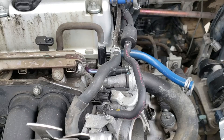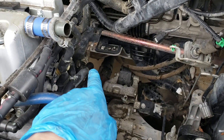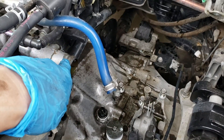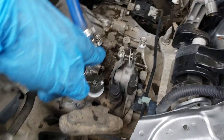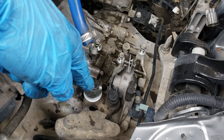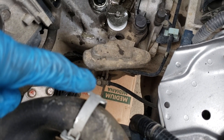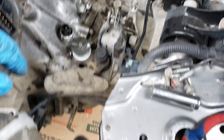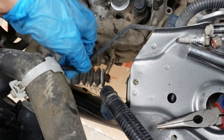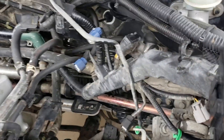You want to unhook all those and then lay it up there. I went ahead and took out the power steering line. Next I'm going to work on taking out the hoses. After getting the heater hoses removed, the engine block hose that goes to the top radiator and then the bottom is also removed. I went ahead and disassembled the shifter cables and put them to the side. Now I'm going to get this 10mm ground right here.